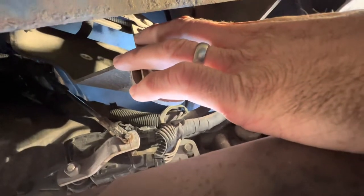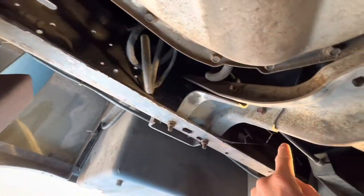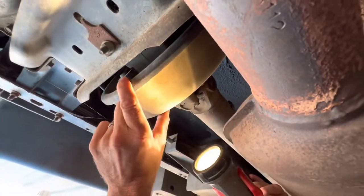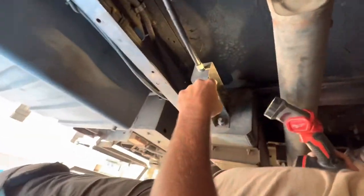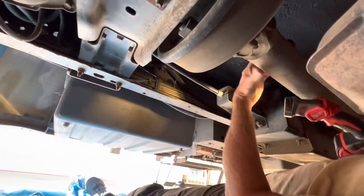So you've got to do it quick — and it's so tight up in there I don't know how you get your hand out of the way. What I did is I followed this side of the cable, and it goes up over the transmission and back over to the passenger side of the transmission, then shoots back over to this hydraulic ram right here. This cylinder you see here is essentially a drum brake right on your drive shaft — that's what locks it up. When this ram pulls it, it locks up that drum brake and you will not go anywhere.